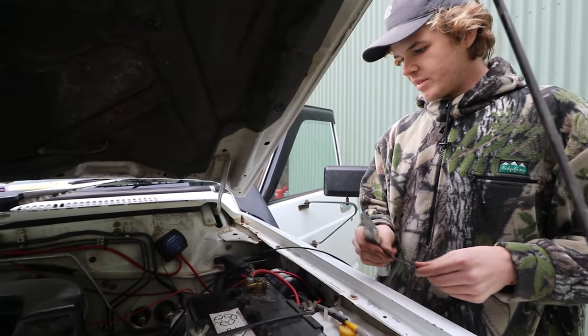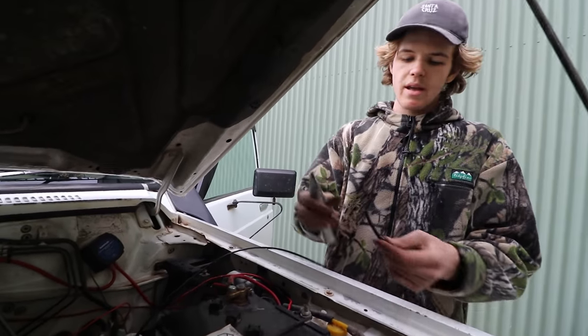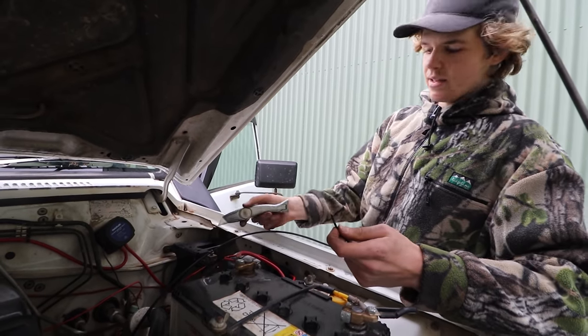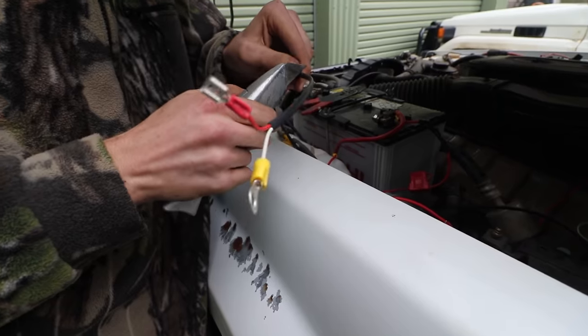All right, so last sort of step. Got our wire here from the lights, which will just run through the bung in the bottom of the car out to the engine bay. So pretty much the positive wire is going to go to the relay, and then the earth, we're just going to ground it here in the engine bay where the other ground point is.